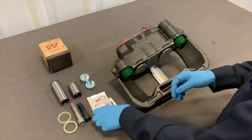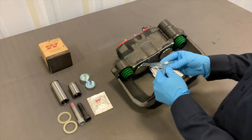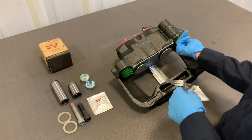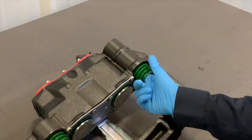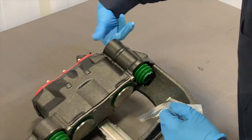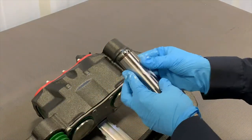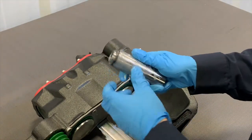Position the new Webb caliper onto its back so that the new guide pins can be installed. To avoid contamination within the guide pin bushings, use new gloves or clean hands to apply grease to the bushings. Use one pack of grease per bushing, and ensure that an even coating of grease is applied to the bushings and guide pins. Use only the grease provided in the kit, as some types of grease can cause degradation of rubber components.